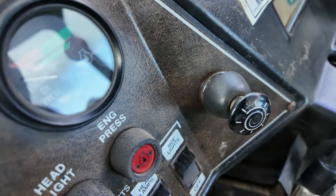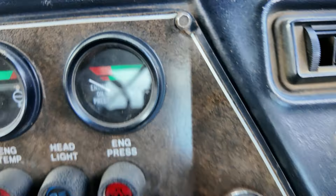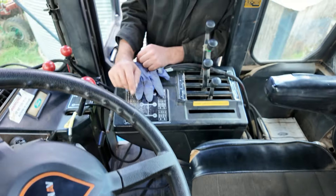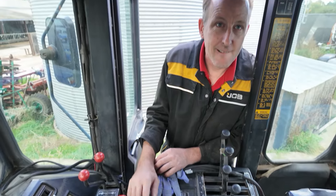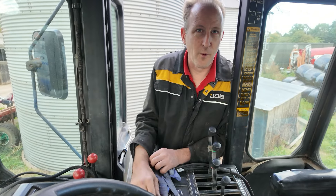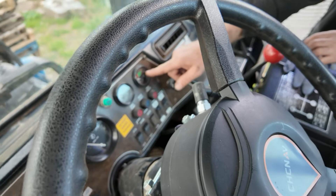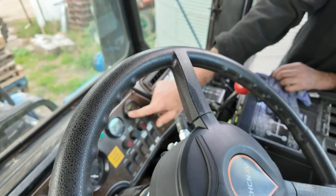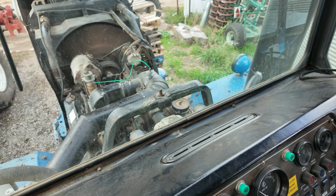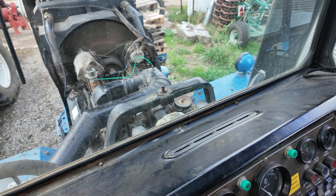That's great. I know why that is - wrong ohms resistance on the sender. There were choices - only about 15. I went with one that seemed like it did the widest band. It did go up when it first started - went all the way to the top, then back to zero. I think it's just gone over resistance on the sender, so the gauge has just dropped off. We need to know what ohms resistance we really need.